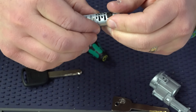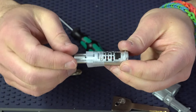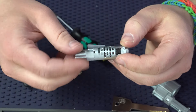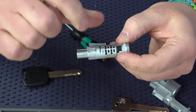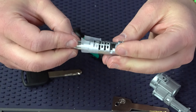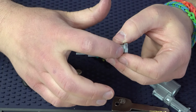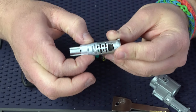If I don't have that piece of tape on there and I'm trying to key it up and I have to stick that screwdriver in, I could easily pop out one of the wafers I just spent time putting in. Putting the tape on allows you to keep moving and not worry about wafers falling out. I've tried to key these without scotch tape and it's like two steps forward, one step back — it gets really frustrating. So just take some scotch tape, put it on, and keep going.